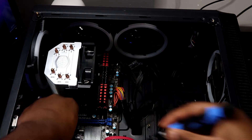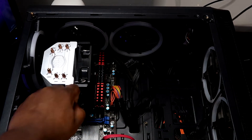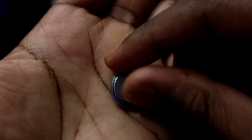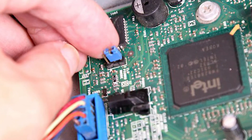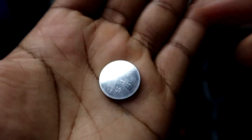This is a very old motherboard — an i3 board. For old boards, you just need to remove the watch battery and that will clear the CMOS. Other boards have a two-pin switch that you can move and then hold the power button for about 30 seconds to reset the CMOS. Put everything back together, replace the watch battery, and hopefully when you press the power button you should get a signal on the monitor.